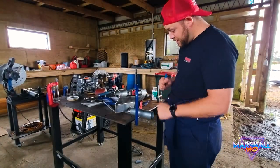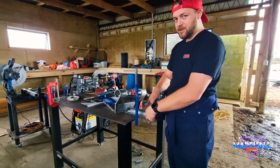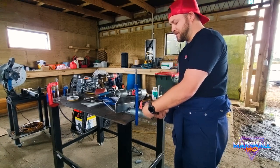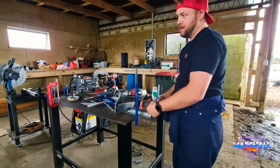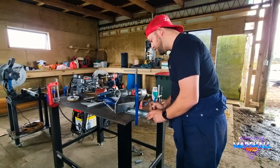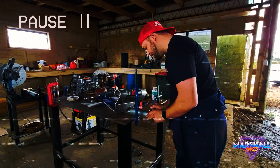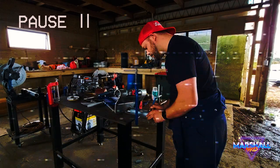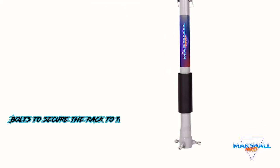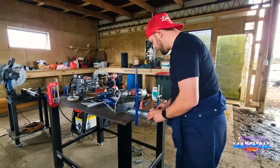This part is a guesstimation. I was trying to work out which way it would go — would it go forward and sideways to lock it onto the tow ball, or would it go from each side when you're clamping it on? I feel like you need something holding it backwards and sideways, so I'm gonna do front dead center. If that made no sense to you, it didn't make any sense to me either — let me run through it. What I'm talking about is these three locating bolts at the bottom of a bike rack. They basically wedge it onto the tow ball so it can't go anywhere, and that's what I'm doing here, front and sideways.